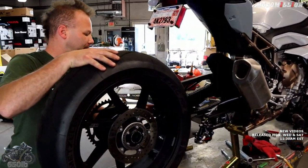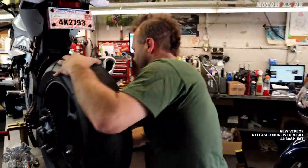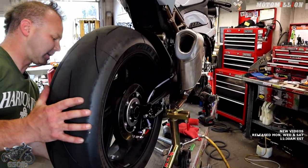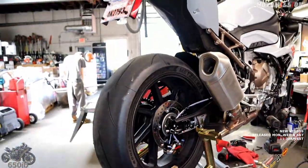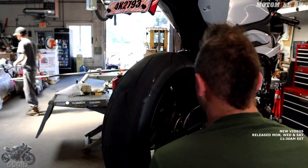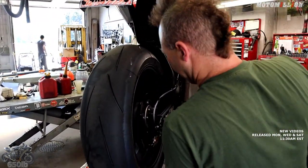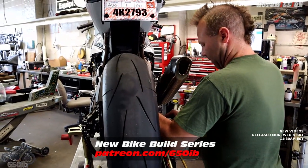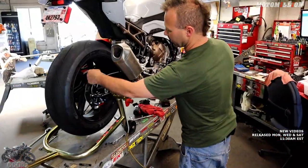This is one of the main reasons you'd want to use this system on your motorcycle - besides the fact that you can run the really nice Brembo caliper and lower the center of gravity. Now when you go to put your wheel back in, we can just move our chain up to the back of our chain adjuster. You do have to finagle it just a little bit past the caliper so you don't scratch your wheel, but once you're in this far everything's still hanging. I'm able to just pick this wheel up easily, set it in the caliper - where usually I'd be fighting with wheel spacers - and now the wheel is retained just like that. Then we just need to slide our bracket forward to line it up with the axle and chain adjusters, and it just goes straight through, locks in place.